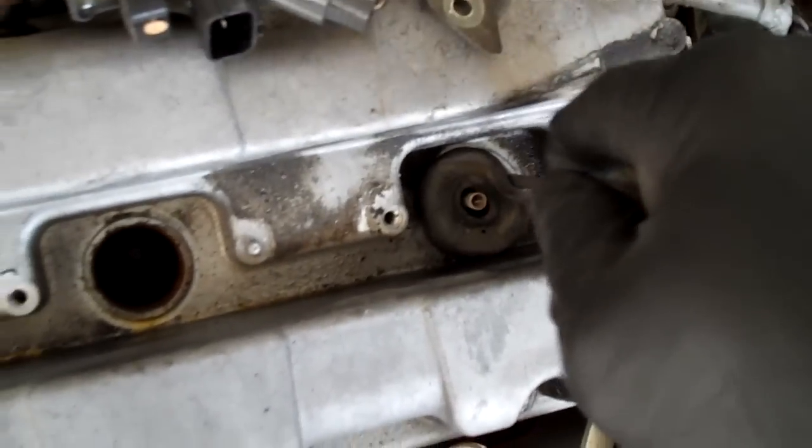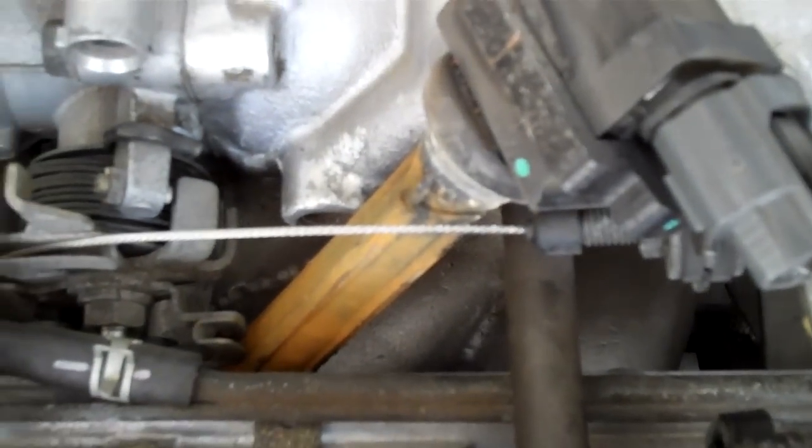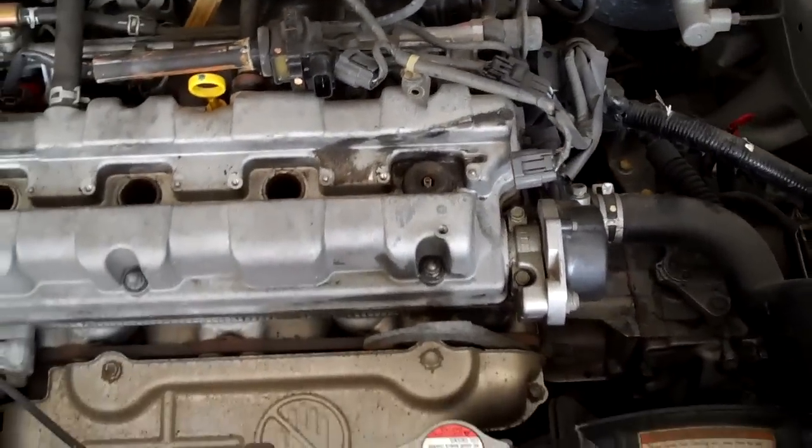Notice how I start on the uphill side — that helps it run down around the rest. The spring in the middle is pretty corroded too, so we're going to go ahead and replace these horrifically nasty spark plug tube wire boots. That's the trick to getting them out; otherwise you will have to cut them out and it will be very difficult.